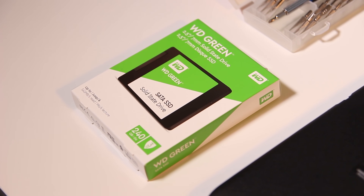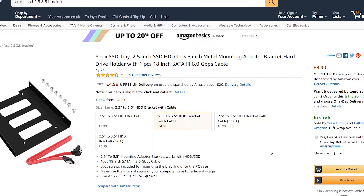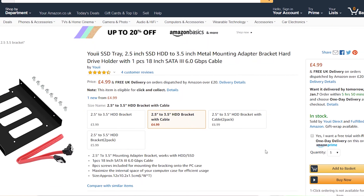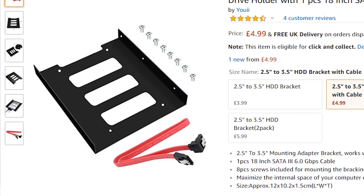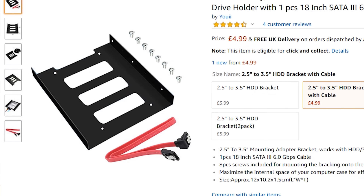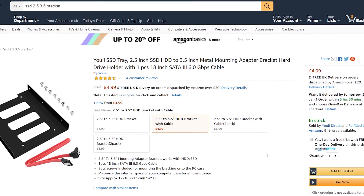If you have a desktop PC, you'll probably find that the hard drive you're pulling out is larger, but SSDs don't come in the larger desktop size. So you'll probably need to order a bracket to convert the regular 2.5 inch SSD to fit the 3.5 inch fitting in your computer. Look online for an SSD 2.5 to 3.5 bracket — they're quite cheap. That said, have a look inside your computer case because some cases now come with a fitting for the smaller drive size.